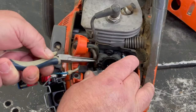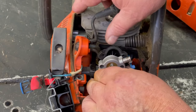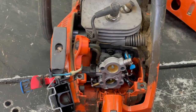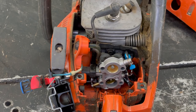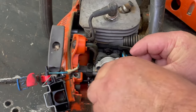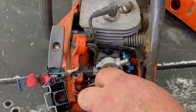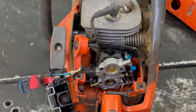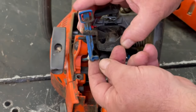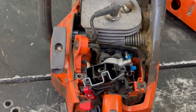And the return line. Okay, take your time because there's a lot to do on these Husqvarnas — there's more to do on these than a lot of the other chainsaws. We'll lock that into place and leave this loose for now while I get the screws in. On this choke, see how it's spread apart — we push it into that hole in the carburetor for the choke and that bracket down there, so do that next once we get that lined up.